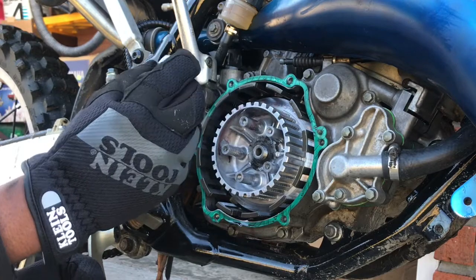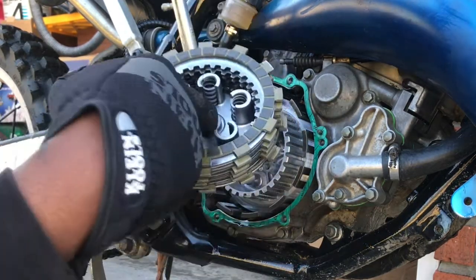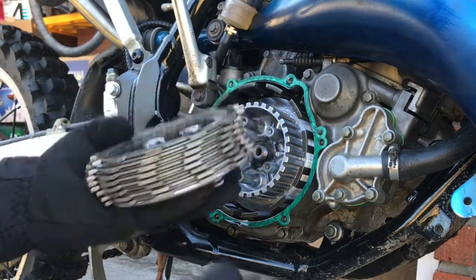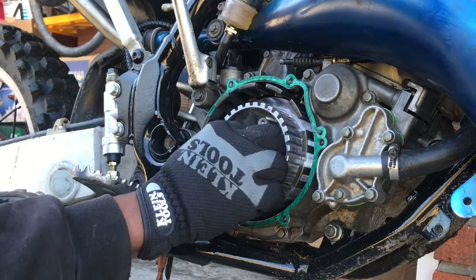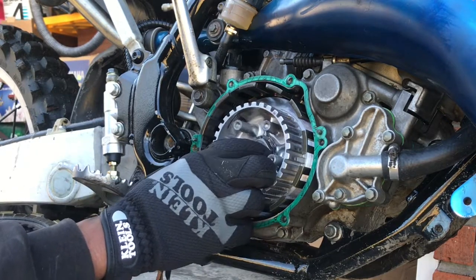This is what happened here. We lost the full clutch once this nut came down and slid down, because our little lever that holds tension on our clutches had nothing to press against. So this is what happened right here. The nut came off. We're gonna lock it back down.